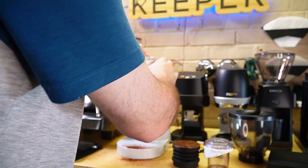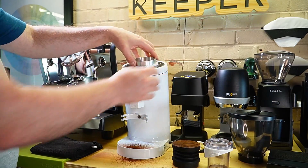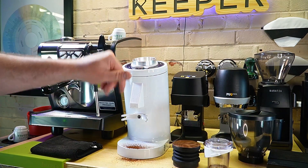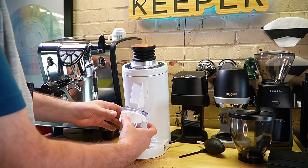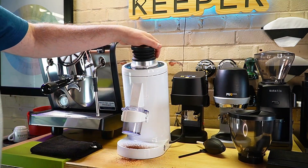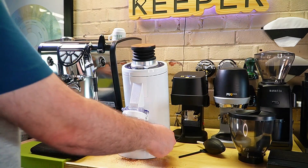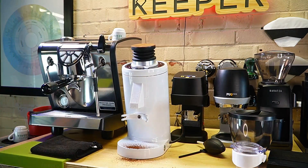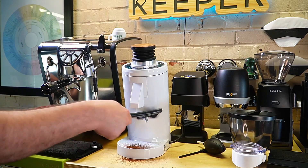So it's about my zero point with these burrs — I'm going to back them off. I recommend re-zeroing this. Put your bellows back on, put your cup back on one last time, just to get any of those residual grounds out. This will make a bit of a mess — it's good if you have a brush, you can clean up your grinder pretty quick and easy.